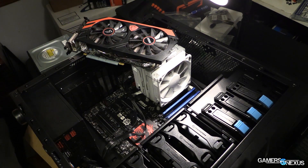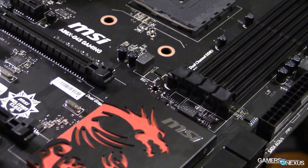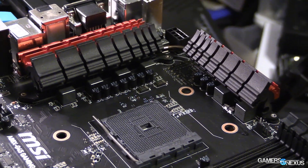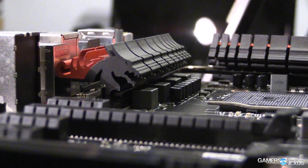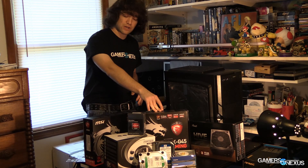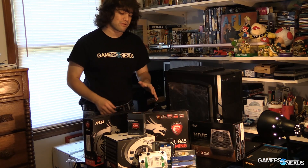For the motherboard we've got an MSI A88X G45 Gaming board. Because it is an A88X chipset, it's going to work with both FM2 and FM2+ CPUs, so if you wanted to drop a Kaveri APU in there you can totally do that. It won't give you huge advantages over A85X since with Richland we can't take advantage of PCIe Gen3, but you're not going to exceed Gen2 bandwidth anyway. It supports two video cards in X8/X8 for Crossfire, and overclocks memory up to 2400 MHz.